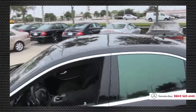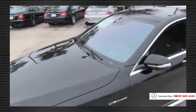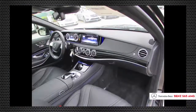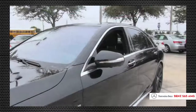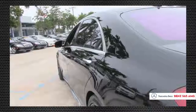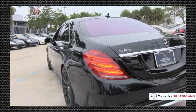The S63 in the US market comes only with the Mercedes 4MATIC all-wheel drive system and features the Airmatic system. Magic Body Control is available for the S550 in the US, while it's standard on the S65. What really sets it apart is Road Surface Scan, which utilizes twin stereoscopic cameras mounted above the rearview mirror that can detect bumps up to 45 feet in front of the car. This data almost instantly preloads the shocks for the upcoming bump.